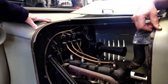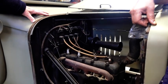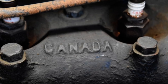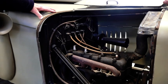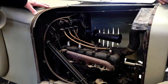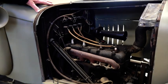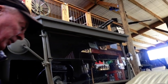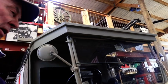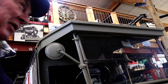When it's running, these trembler coils are like a vibrating doorbell — with a secondary coil it generates a high spark which makes the engine go. It's an amazing feat: no water pump, no petrol pump, no oil pump — it's on there and it goes. He made 14 million of them. One quirk was going uphill — you'd run out of petrol because the tank is under the seat, so you had to turn around and back up the hill until you got to the next gas station.